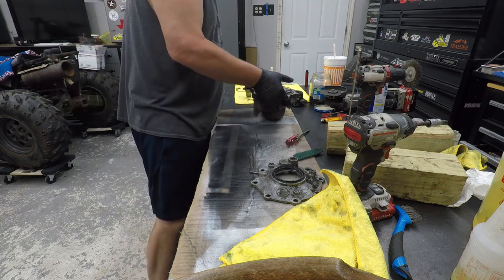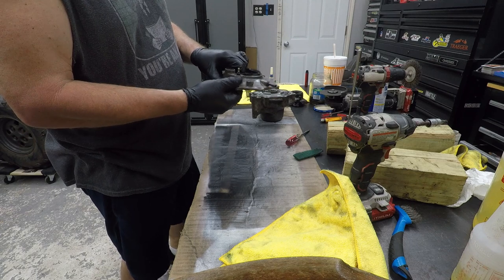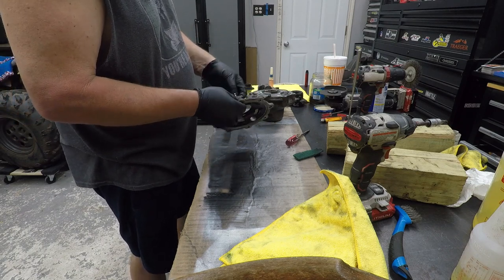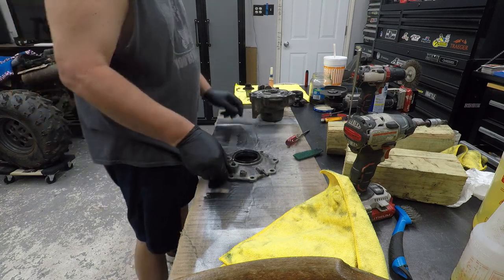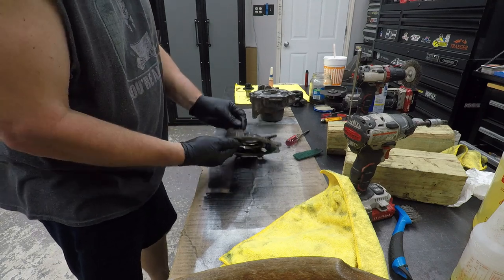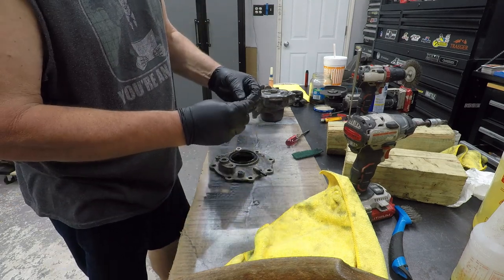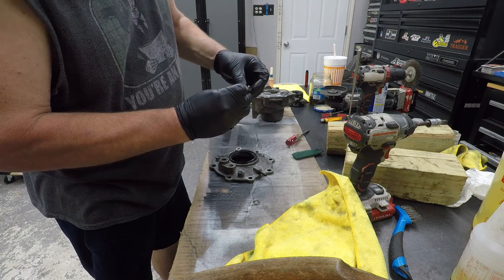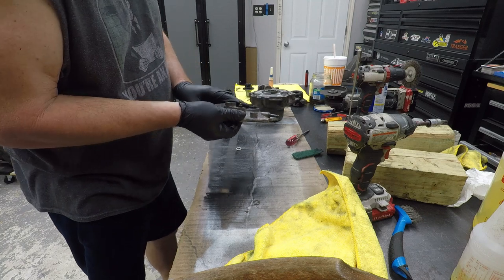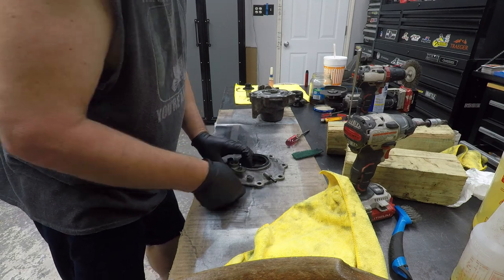Okay. Now, what you probably didn't see was this thing here, which I guess is a ground. Pops in there, polished up that end. There's a little O-ring. It goes right there, but there's a washer and an E-clip. So the washer, nope, I'm sorry, the O-ring goes on it. Get the dust off of it there. The O-ring goes down over it. Like that, and then it goes in there, and that's what creates the seal. Alright, and then you get this washer, and this E-clip pops on there.